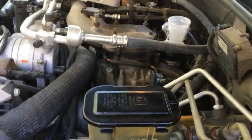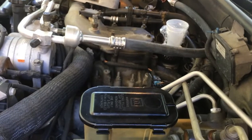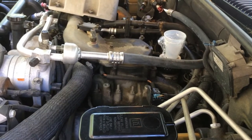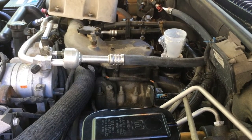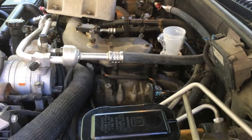I've got another video for you — we're going to be taking a look at a lift pump problem. I just did the fuel filter and I like to put a little cup on the top of it to catch the fuel when I bleed it. When I turn the key on, normally on this '99 series that's enough to have the lift pump go, but the key's on and nothing's happening, so we're going to take a look.